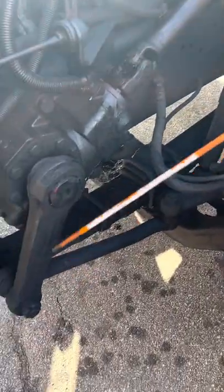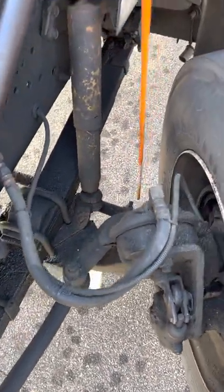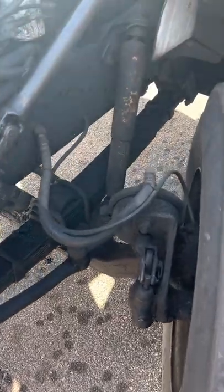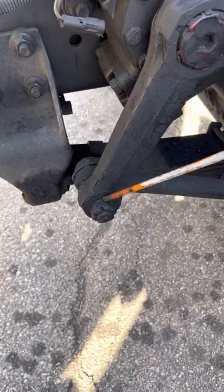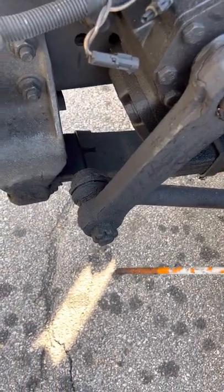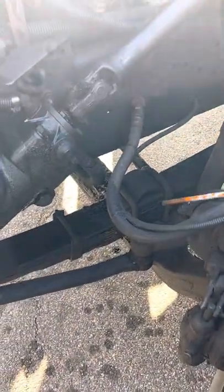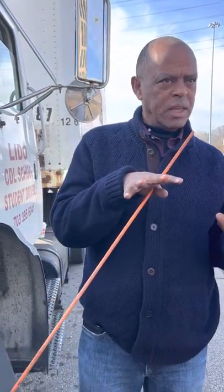This is a pitman arm. This is a drag link. On the top there is upper control arm. On the bottom there is lower control arm and also the tie rod. Each end individually they are connected by castle nuts. These castle nuts have pins — make sure the pins are not missing, it has to be present, the castle nut has to be tight and secure. On the back of the castle nut there is a ball joint — that ball joint needs to be greased and lubricated all the time. Make sure they are not cut, not cracked, not bent, dent, or illegally welded.